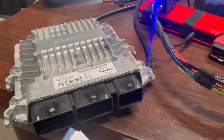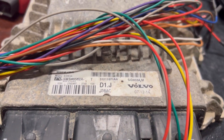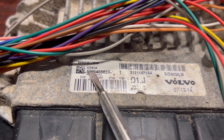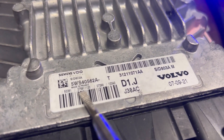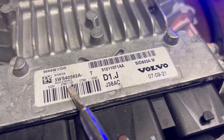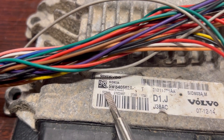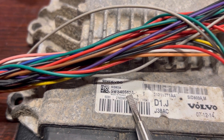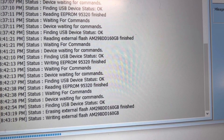We don't even need to read from the replacement — we just need to write to it to do a clone. To find out what ECU you need: look at this number, make sure it says 803A, and then verify this hardware number. I've been making sure the same number fits. Some other numbers can be different — that's not a problem. The main thing is the hardware number — basically the inside of the ECU — which is very important.